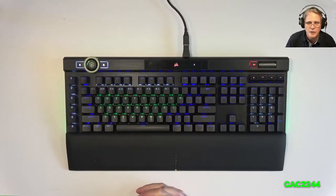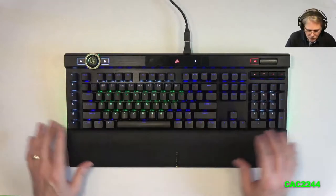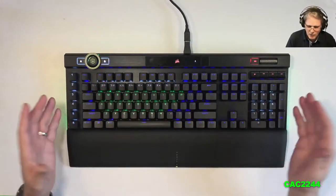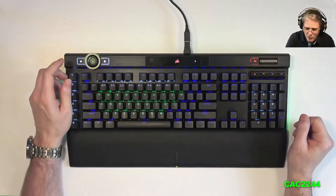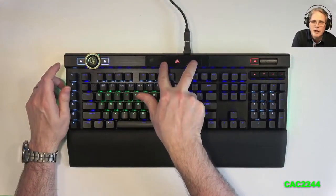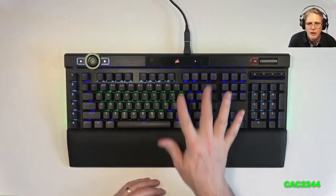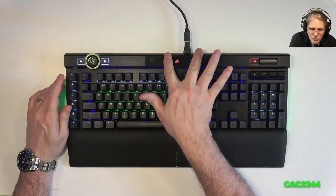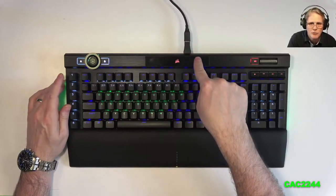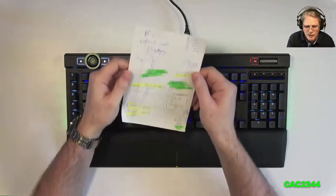In the previous video that I linked already, I do show how to open the keyboard. There's a whole bunch of screws. You remove the keycaps, 17 screws, 4 screws under the keyboard, and 2 screws on the top here. You cannot remove those from the top; you have to go from underneath while the keyboard is cracked open, and it is destructive. So you need to know that it is destructive. And I'm going to show you a diagram and the footage as I was doing that.